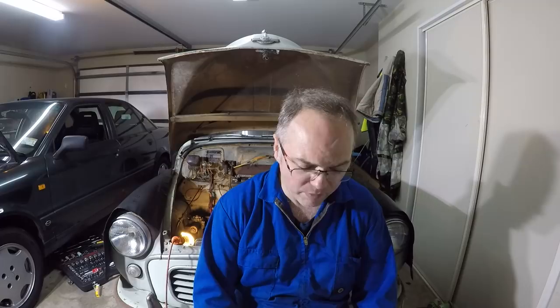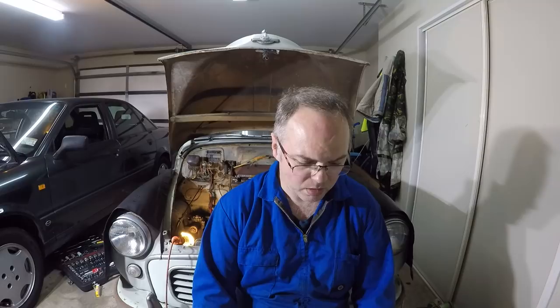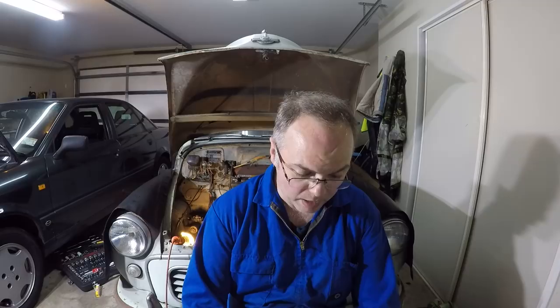Our valve clearances, we had a couple of tight ones. Our tightest one was valve number one, which is on our problem cylinder, so that could be an indicator of which valve is a problem. The rest were pretty good. I set them all to 15 thou. Again, it still ran the same, popping out the exhaust. Didn't really expect any different, but gave it a try.